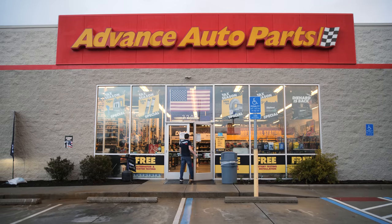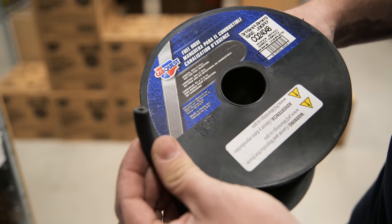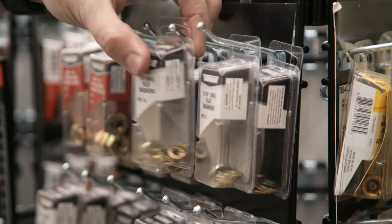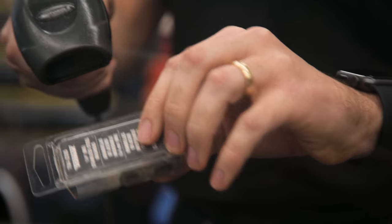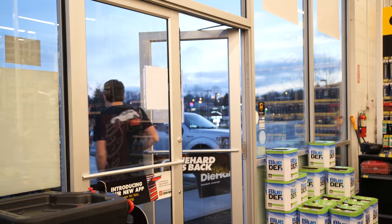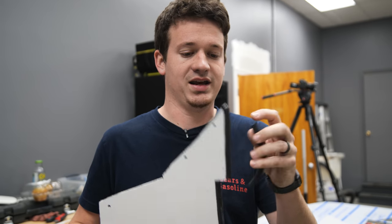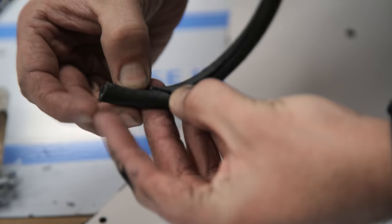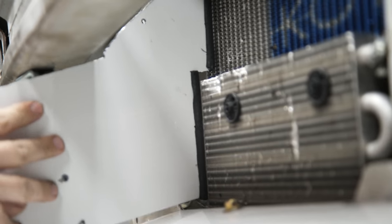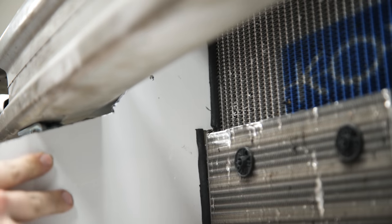I'm going to pick up some rubber hose to protect the edges of my ducting, some spare bolts — a lot of spare bolts — and a few more drill bits. With this ducting, we want to get it as close to the radiator as possible to force all the airflow through it. Some parts might touch, and I don't want metal-on-metal contact to rub a hole through my radiator, so we're putting fuel hose on the end here as a makeshift grommet. You can use this in all sorts of applications — if you have metal-on-metal contact that might be rubbing, cut some hose, put it on the end, and it won't rub anymore.